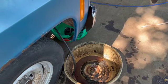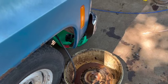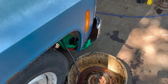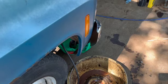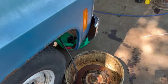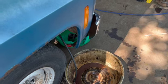Unfortunately, there's not any draw on the other side where I've got the other pan set up to actually go ahead and pull fluid from a fresh jug. Now, if I had a setup where I gravity feed it, with another funnel set up, and then run transmission oil into that, I could gravity feed it back in on the return side and just keep going and let the engine run.